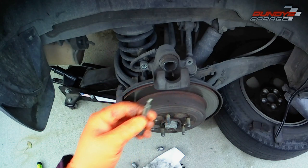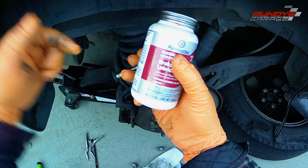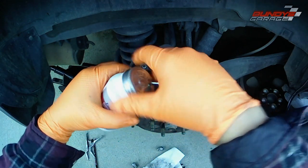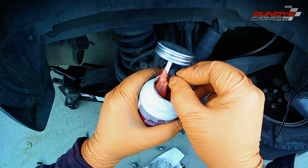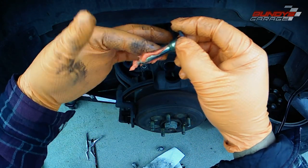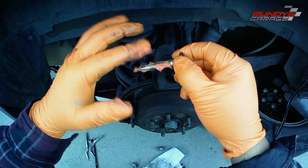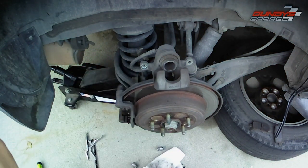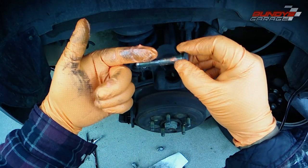This is the kind of grease you need — we'll put a link in the description below. It's Permatex full synthetic silicone grease, orange in appearance. You basically clean off the old grease from the slide pins with brake cleaner, then work some of the new Permatex grease into place and coat it over the pin. You're going to do the upper one and the lower one, and then the caliper will be able to slide in and out real nice. Do not get that grease onto the rotor or on the new brake pad friction material.